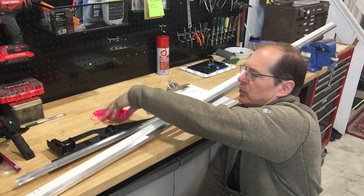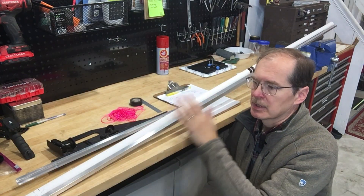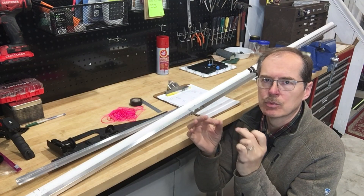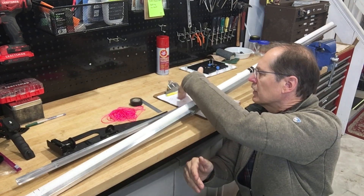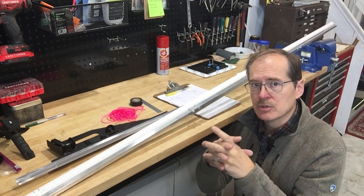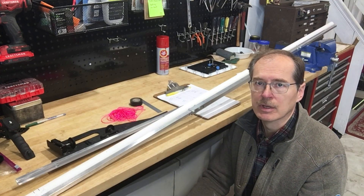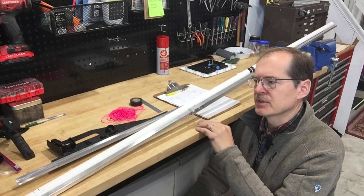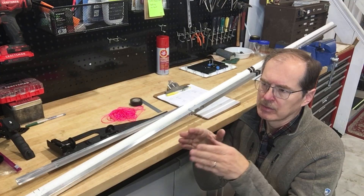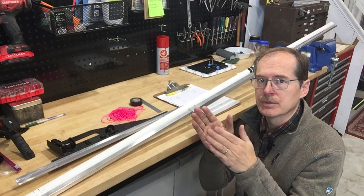In the previous episode we used string, tape, basic measurement devices, and separator bars to come up with what is called a parallel string method, where two strings are parallel to the car and then you take measurements to the rear wheels and the front wheels. Through some calculations you can figure out how much toe-in or toe-out an axle has. For the Jaguar F-Type you specifically want a little bit of toe-in at the front and at the rear. But this method didn't give us what's called thrust angle — whether the toe-in on the rear wheels is pointing equally down the center of the chassis or biased to one side.